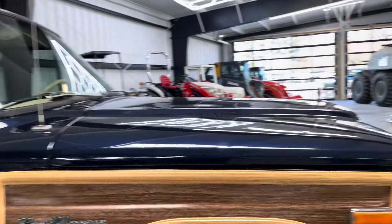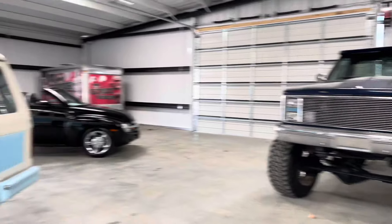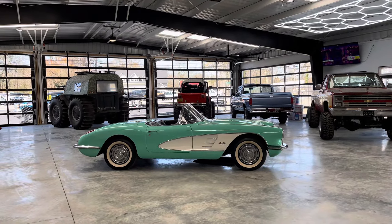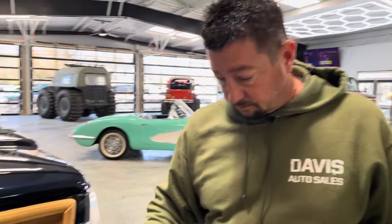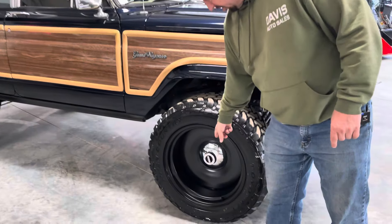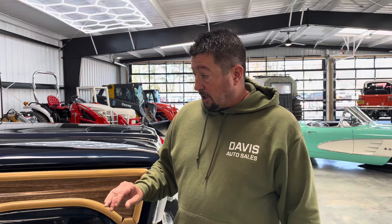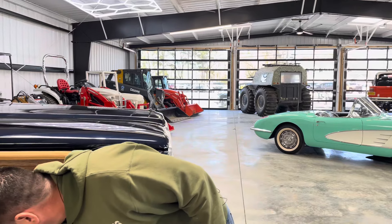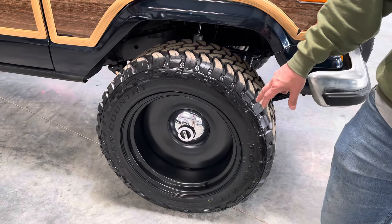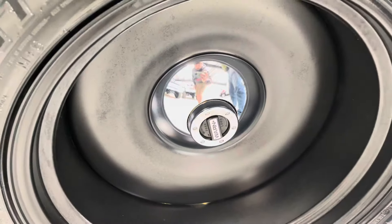So the Grand Wagoneer is up and available and really sweet. Then there's the old baby Bronco and the C1 Corvette. No matter what you're into — Ford guys, Jeep guys — Grand Wagoneers have a following all their own. I did do a video on this earlier. Tons of custom touches: all this trim has been replaced, we did the lift kit, wheels and tires. We had the wheels custom built and powder coated. When Brian Daniel went to put them on, one of the big things was the baby moons to make them look cool — but they don't make baby moons with a four wheel drive hub hole. So we had to put it on the lathe and turn it down. Turned out slick as heck, such a tight fitment you can't even tell.